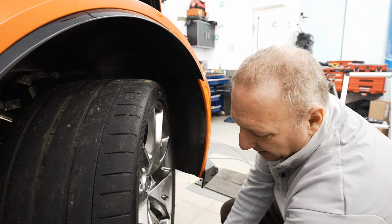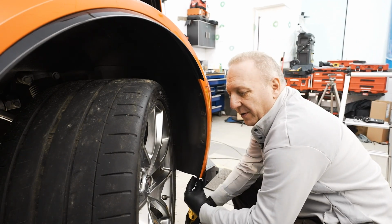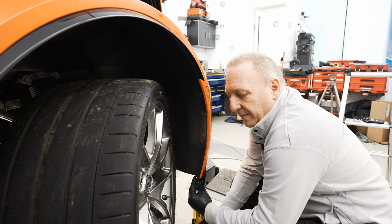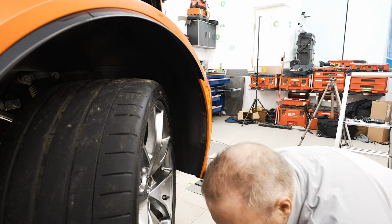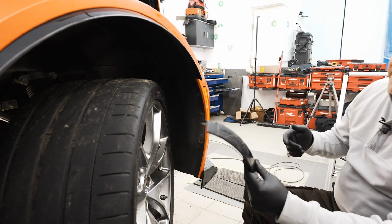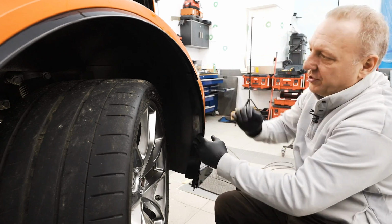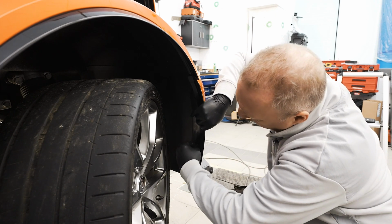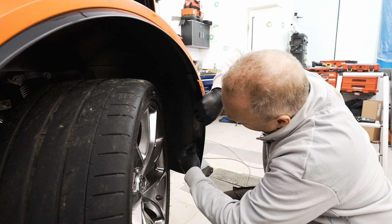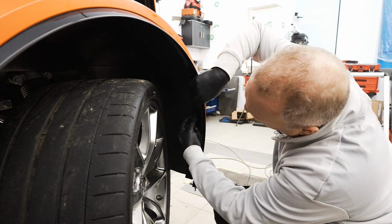I also noticed I too eagerly installed the 7mm screw. So if you do have a Z06 or Grand Sport, the screw should not have been installed. Fender extension, if you have the single piece, you'll be bending it back into position. If you have the ACS one, it's a single part. Three T15 screws hold that in place.